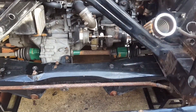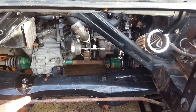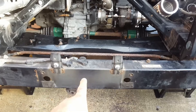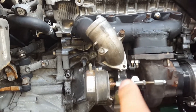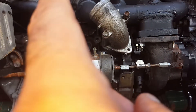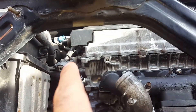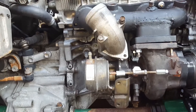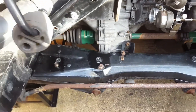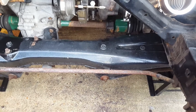So now I've got to work out what the rest of the exhaust system is going to do. I want to have the exhaust system with a little cat in it and then a little silencer. The turbo compressor side outlet needs to make it through an intercooler and into the inlet manifold up there. So I might need to clock the turbo a little bit. But first of all I need to get my intercooler kit out - I'm fitting an air-to-air intercooler back here somewhere low down, and the exhaust high up as possible.